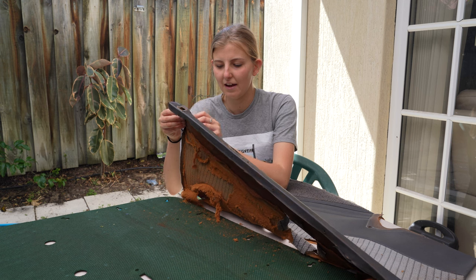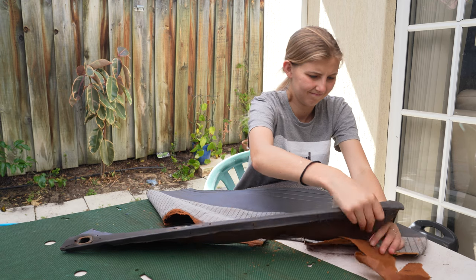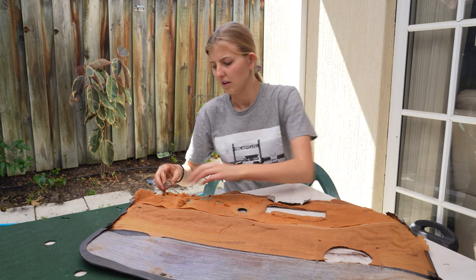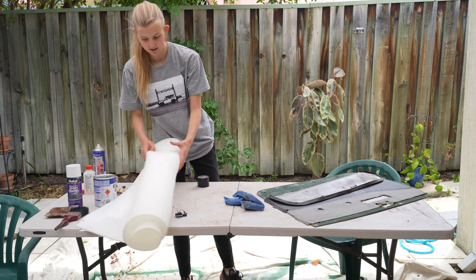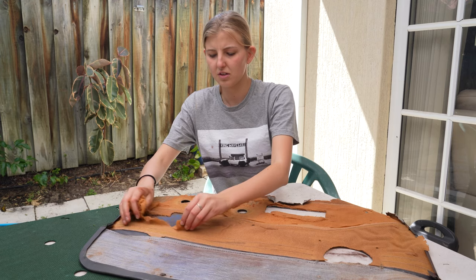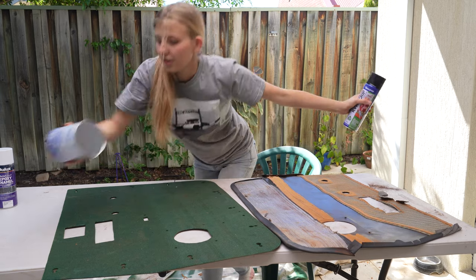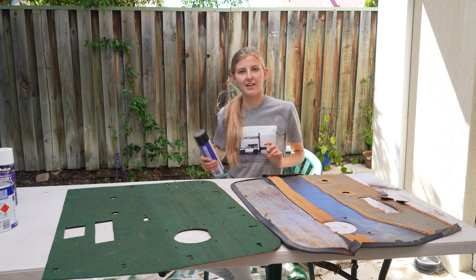Now that my painted backing is dry, I'm going to very carefully peel this top strip of vinyl off of the cover, because we're going to be remaking that one and won't be gluing it onto the board. Once I've done that, I'll make sure to get all of this gross thin foam off the back. I bought new foam, but I'm not going to put it over the whole door card — just on my new top layer of vinyl, because you don't really rest your arm on the rest of it. I've got the quick grip spray adhesive — either the spray or the paint-on version will work, whatever you prefer. I'm going to try the spray.